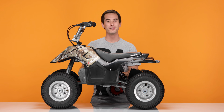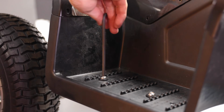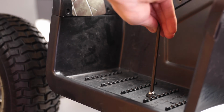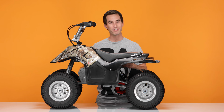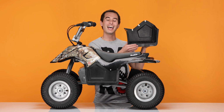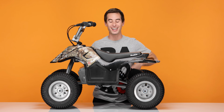With the side bolts removed, we can now remove the 2 bolts on the bottom. Using your 5mm Allen wrench, remove those bolts. And again, these bolts come out with a rubber spacer and a washer. With all 9 bolts out, we can now remove the footstep. Simply lift the back fender and pull it out, and set it aside. And now repeat the process for the other side.